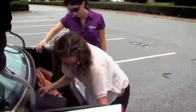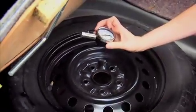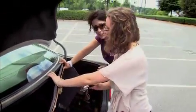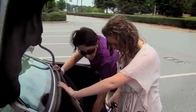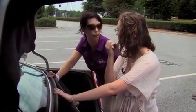She's moved into her car. Yes, we do have a spare tire under here. Very good. What does it say? Just under 30. And what did it say inside the door placard? 60. So do your Nana a favor — put air in this so that it's at 60, because if she ever has a flat and someone says they'll help her, she'll be driving on another flat.